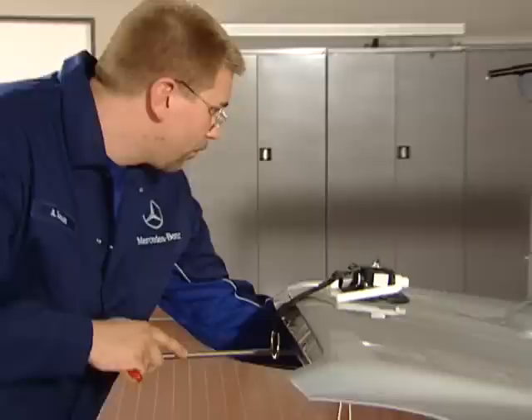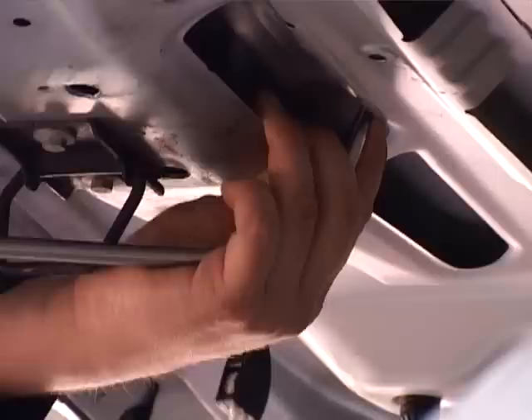Initially, adjust the lighting of the dent until the deformation is well defined from your viewing angle. One of the many basic rules is the spiral method. Then press the spiral metal from the outside inwards.